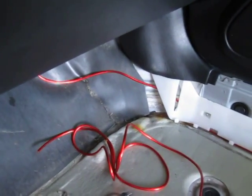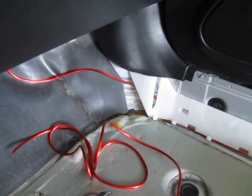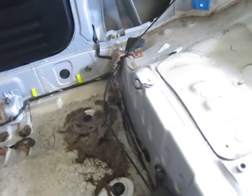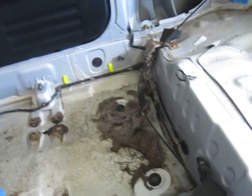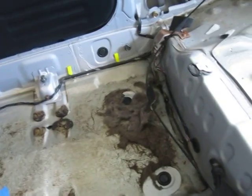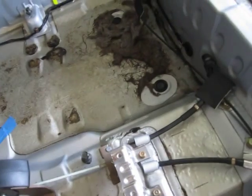Up here in the front corner, I noticed the carpet's been getting wet — I think it's rotted through there, but just in that spot, so that should be easy to fix down the road. I was getting a lot of trouble with the carpet being wet in the passenger footwell, and what I figured out was these caps are just loose. Most of them are rock solid, but those ones were pretty loose and just letting water in. Thankfully, that's not actually a rust issue.